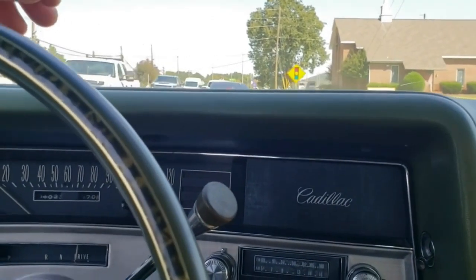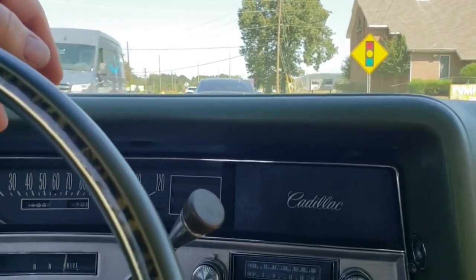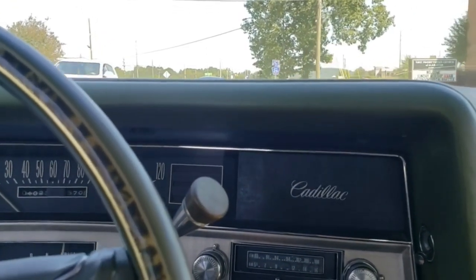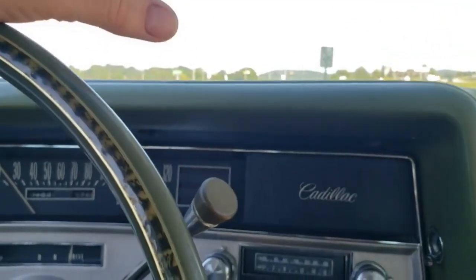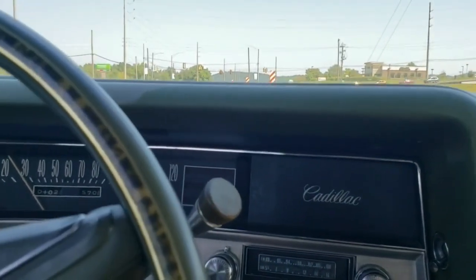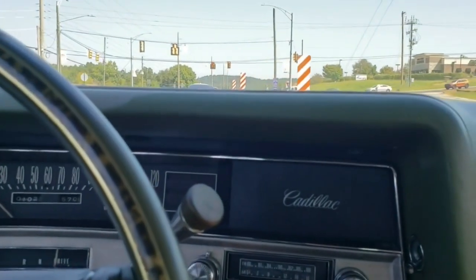But nonetheless, if I sit here and idle at full operating temperature, it's still there. There's also a very, very slight tick from the engine until it gets really warmed up. Not sure what that's about. Maybe a sticky lifter. I don't think the valve stem seals are an issue, because this car, thankfully, cross my fingers before I say this, never smokes.